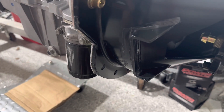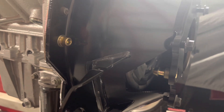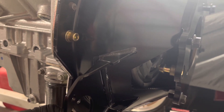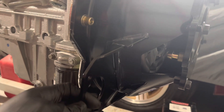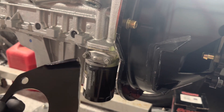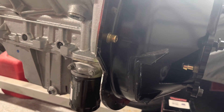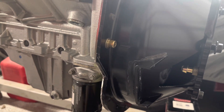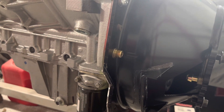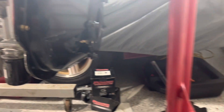I'll show you the piece that was taken off. There was a ridge originally used for the slave cylinder if you're running a traditional system with a clutch fork. I made the cut and took that completely off, because we're not going to need that — we're using a hydraulic throwout bearing from How Racing Industries along with their throwout kit.